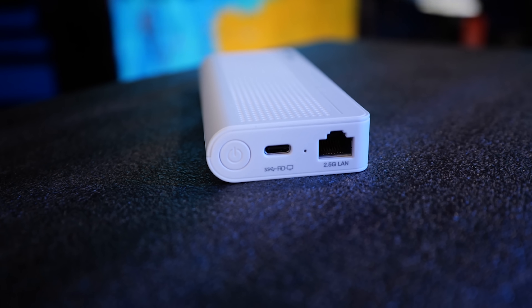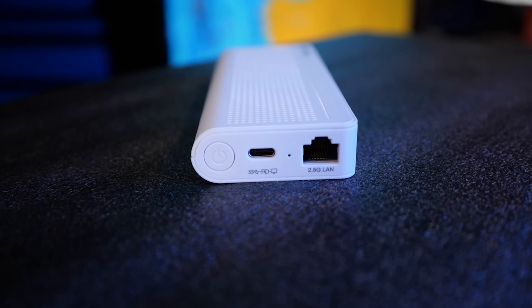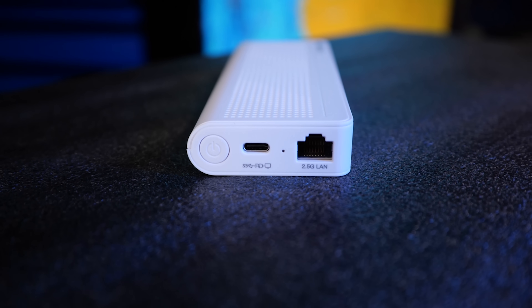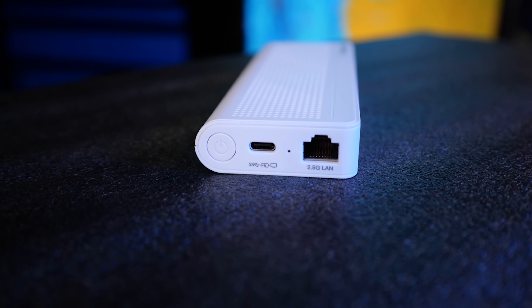I'm actually using a USB-C hub from the PinePhone project that provides ethernet, HDMI, 2 Type-A ports, and pass-through charging. You can plug the charger into the USB-C port on the hub and get all those connections, plus an extra network connection. Does that mean you can use this as a router? You've got in and out — just remember one of those ethernet connections is over USB. I'd use the 2.5 gig side for LAN and whatever's through USB-C for WAN. Technically you could run this off power over ethernet too, but I really would not recommend that given the power delivery problems.